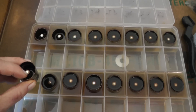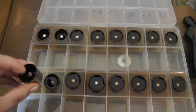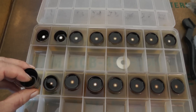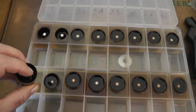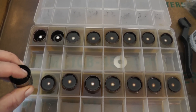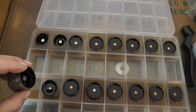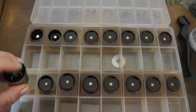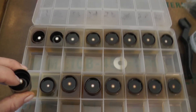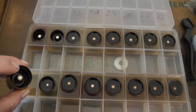If that piston comes up a little bit, you stand a chance that it could actually hold the valve open the whole time while the engine is turning over. He said he's had a lot of people call in saying they got a misfire on a cylinder or two, thinking something was wrong with the valve job. It turns out they never bled the lifters — they put them right back in fully extended with oil still in there. He said in most cases if they ever get extended back out, it'll take forever for them to readjust and find their spot — in some cases they won't.